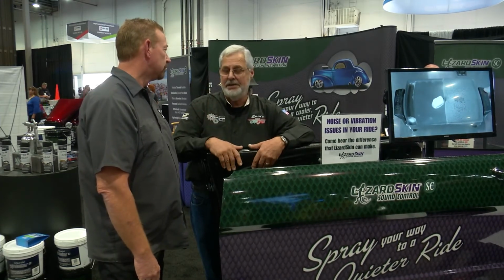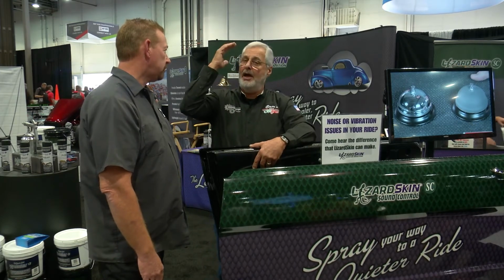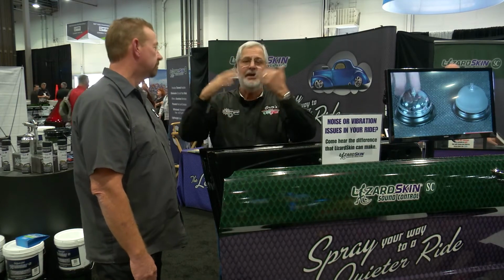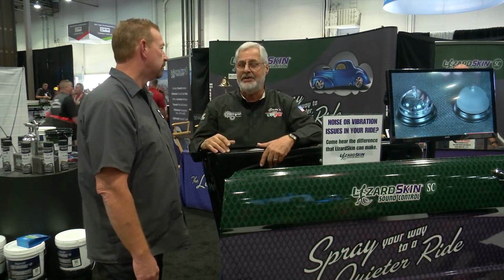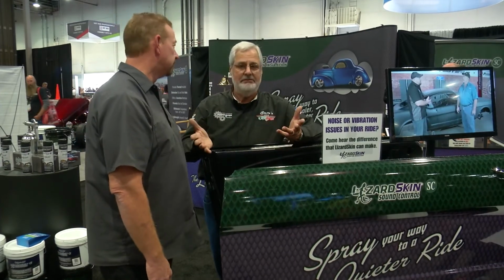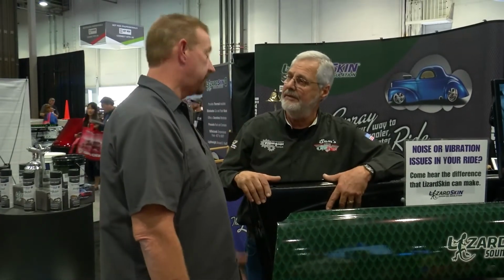Absolutely. And I've sprayed a car with the lizard skin, and it makes it like a tomb inside. Think about it, no matter what you glue on the bottom of the roof, when you put the headliner up, eventually it turns loose in the sun, lays there, doesn't do a good job of insulating, sound deadening. Lizard skin's water-based. It cleans up with water. You wear a mask, but you don't need a respirator. No VOCs, it's safe.